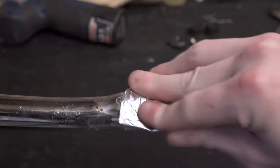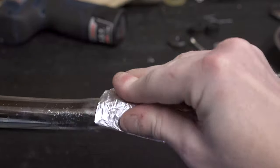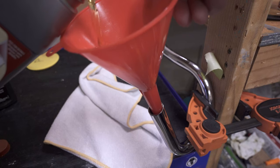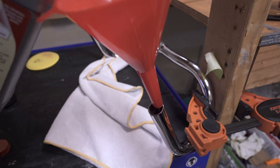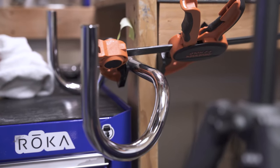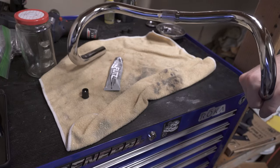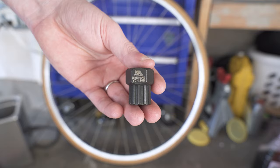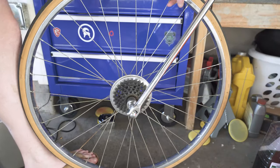You can get a better view of the aluminum foil trick here — it really just erases the corrosion on the handlebars. For the inside, I went with Evaporust and let it sit overnight. That's really where you sink a lot of time into these projects — not necessarily the time actively working on it, but all the time these parts need to sit.